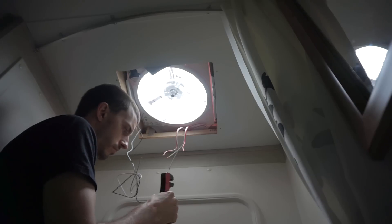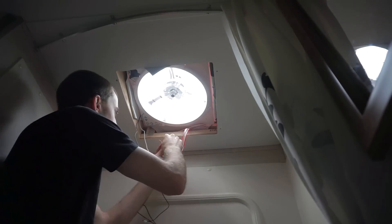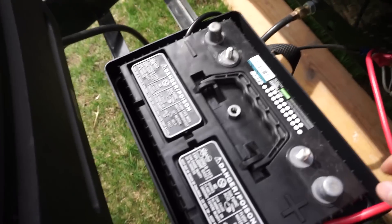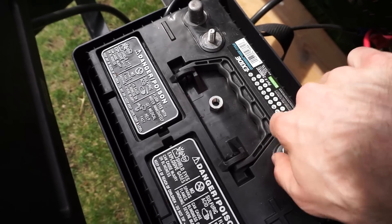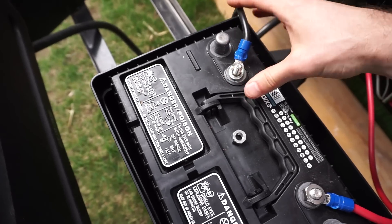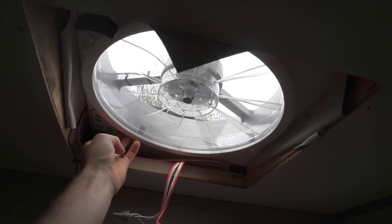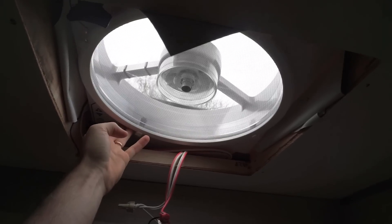The instructions tell me to come back in here and wire this up first, before you make it permanent — before you screw it into the ceiling — just to make sure everything operates as it's supposed to. So I'm going to go ahead and wire this thing up, then reconnect my 12-volt battery and see if everything works like it should. All right, awesome — it works! So back on the roof to screw it down.